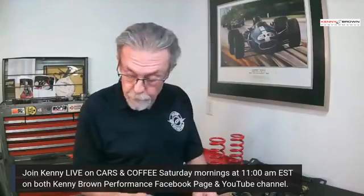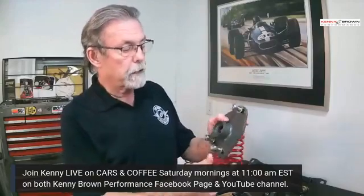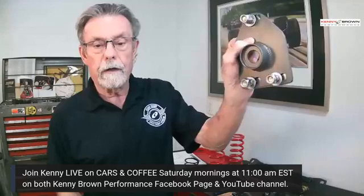Now, here's a little trick I need to show you guys. I keep telling you how to do track setup and street setup. Well, this is the Fox, and I'm going to show you what I mean. Let's say you go to the alignment shop, and that's your street alignment. What you do is, either on here or on the body, you make a little mark where the bolts are. Okay, and your Sharpie.